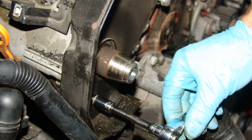With a soft cotton rag, thoroughly clean the cam seal contact area. Inspect the camshaft for a possible groove where the old seal engaged the camshaft. If the camshaft is grooved, recess the seal a few millimeters deeper so that it rides on a new mating surface. Be careful not to scar the camshaft. This can cause irreversible damage to the cam, resulting in an unsealable camshaft and subsequent oil leaks. Lubricate the lip of the new seal with clean motor oil.